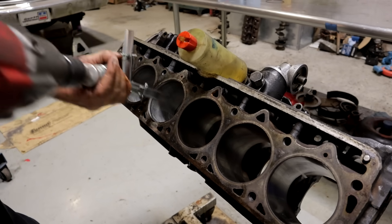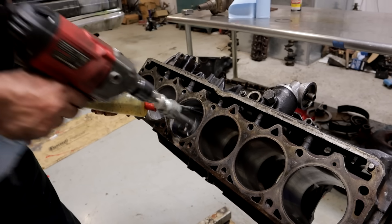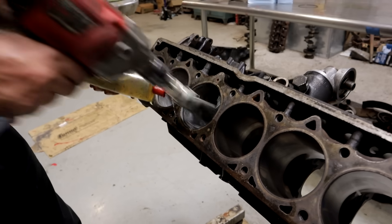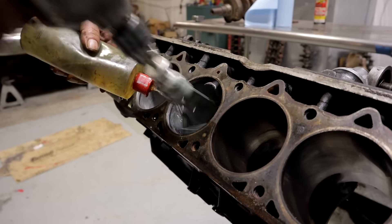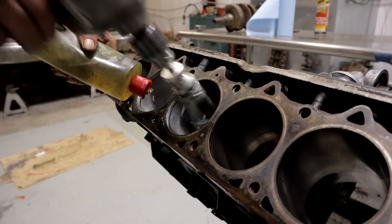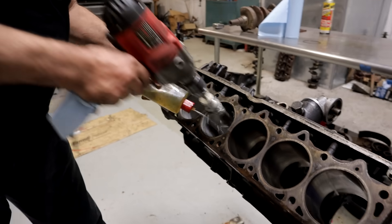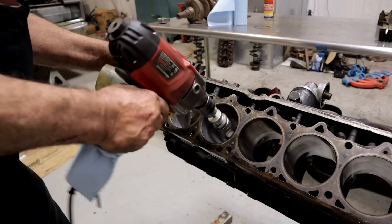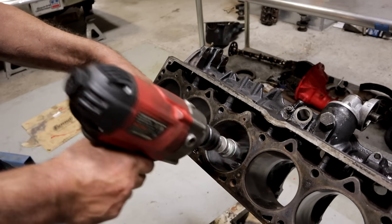On this engine, there's a light discoloration area far down the cylinder but I see my marks going right through it, so I know that's nothing to worry about. I want just a little more angle on this — I'm going to slow down the RPM of the drill and increase the stroke a little bit. You have to try to stay as mechanical as possible; you're trying to do the work of a machine here.